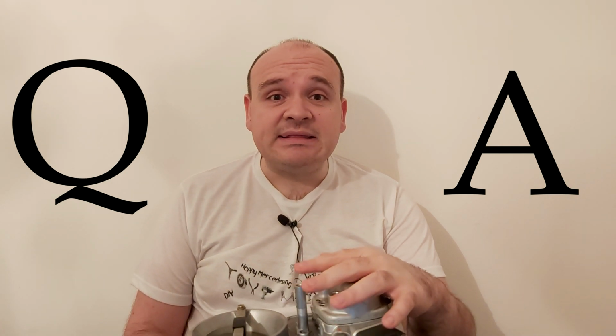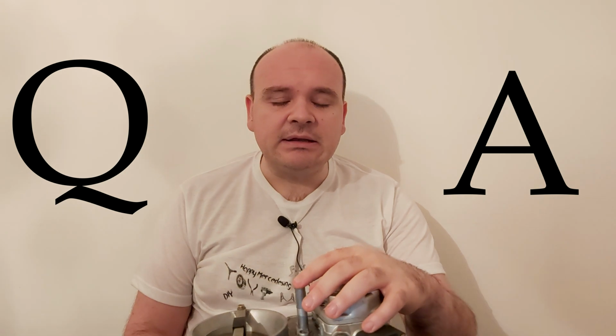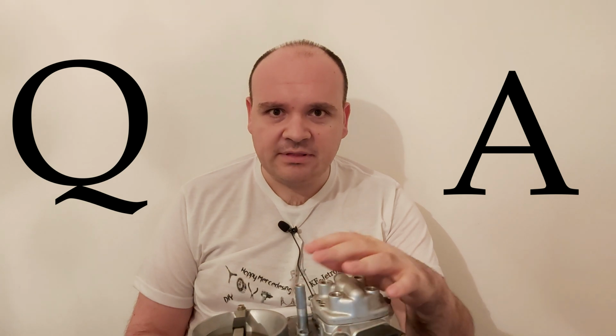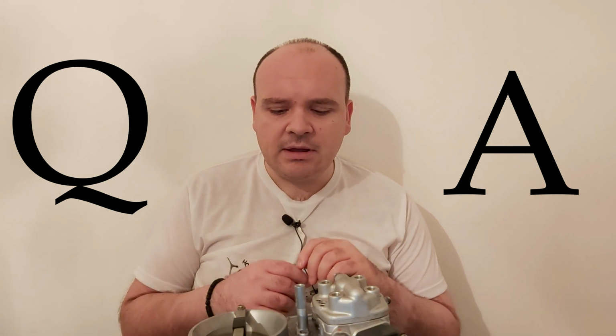Well, for all of you who don't have an O2 sensor, everything on this CO screw, once adjusted, doesn't have to be readjusted. Never. Believe me. That's why in Mercedes they put a cork here. So don't touch this screw, and never go to a mechanic that is going to start the car, and then maybe the engine is going to shake a bit.